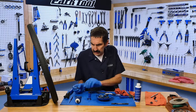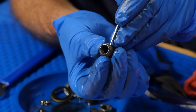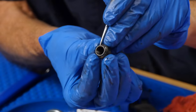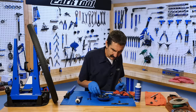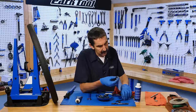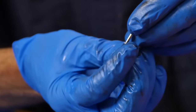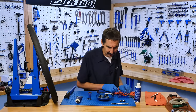We had bearing surfaces inside — let's have a look at these. The shiny part, that's the ball path. If I trace that, I do have some pitting here. The potholes, the chuck holes in the road for the ball bearing have begun. It's not as bad as I expected, but it's definitely there. The other side — some badness. This was not caused by the breakage; that's riding on it, maybe too tight, or definitely riding on it afterwards. Definitely a bad cone there.